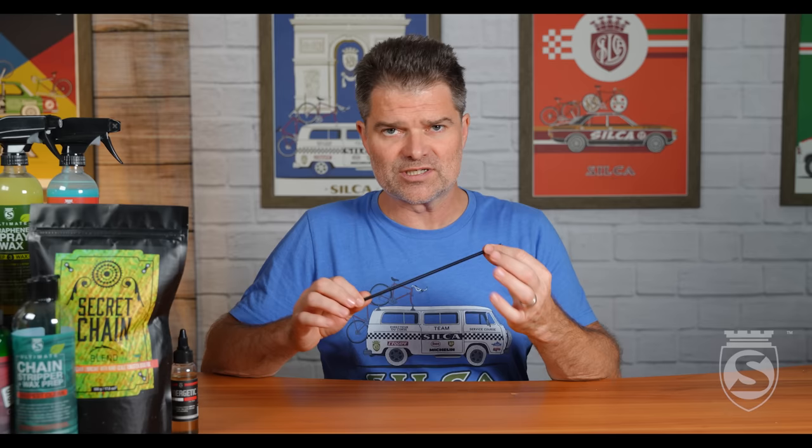We had a frustrated customer come in through our inbox. He said he washed his bike with our bike care products and his spokes turned a sort of brownish-purple. I said, well, that's weird. I know the coatings and treatments they use on stainless steels in products like this, and none of them are going to be affected by anything in our bike care products. So I bought a box of these spokes and started playing, and found that our Detox brake and drivetrain cleaner makes the spoke look brown and purple.